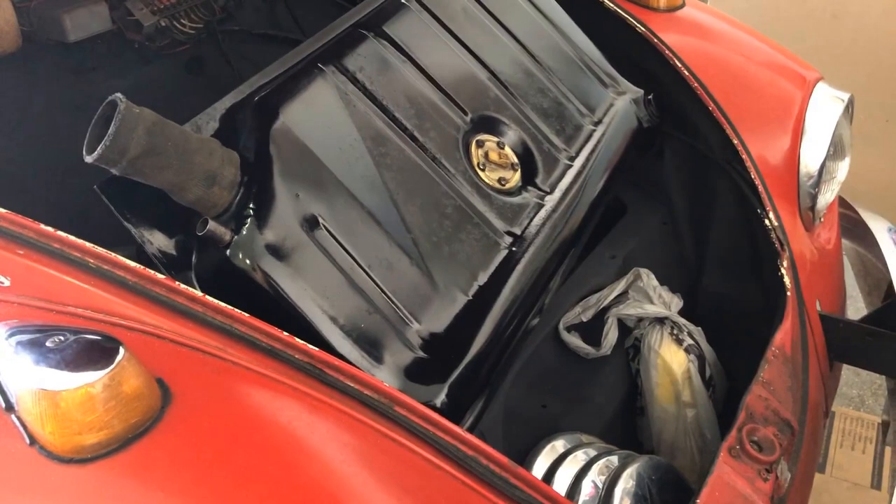Spider! So here I have the tank and I'm going to be putting it in soon. I've already hooked up the fuel line to the bottom and I'm about to hook it up to the tunnel connection. Just trying to figure out which way to orient the worm clamp — I haven't decided whether to do it down or up to gain access for later, or pull the whole tank and get it from the top. Either way, it's coming along. The top one's tight and I've just got to do the bottom one, then drop the tank in and wait for the brackets to ship.